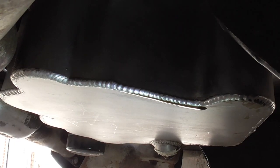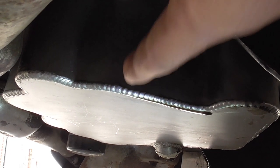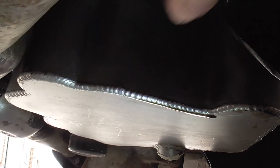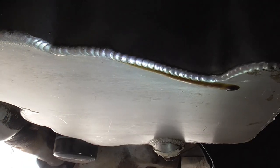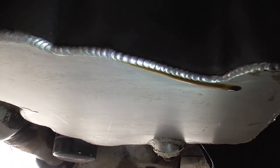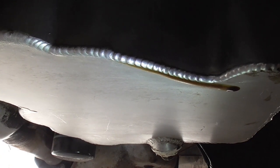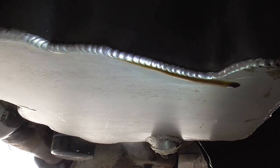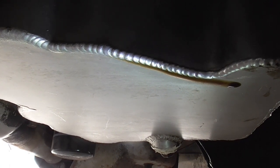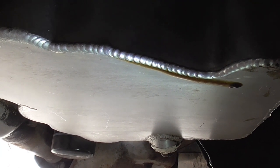You can probably see we're developing a bit of a leak, and it seems to be coming from along the seam — the weld looks like it's failed. The sump plug itself I've not been able to seal, so I quickly bodged it up with silicone so I could go racing this weekend. I was going to try some kind of rubber high-temperature seal instead of the crushable washer, because the crushable washer doesn't stop it leaking.